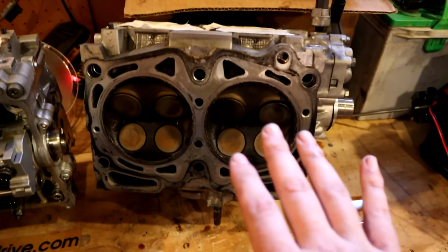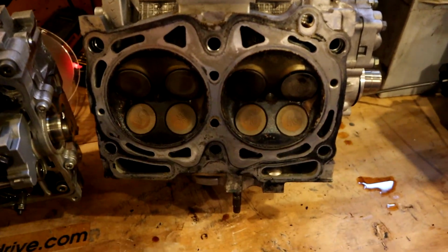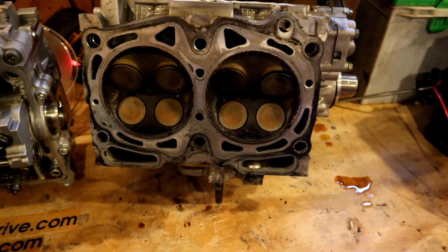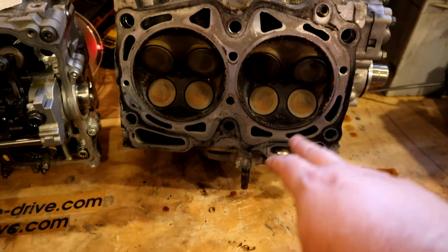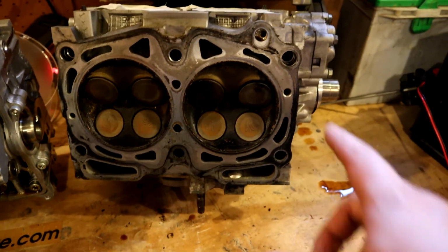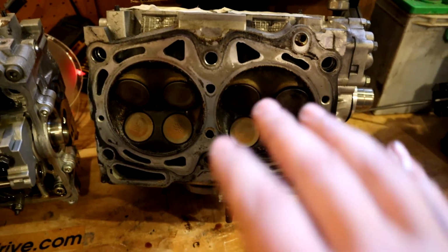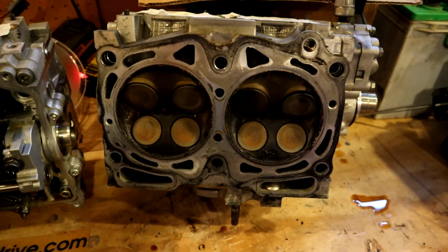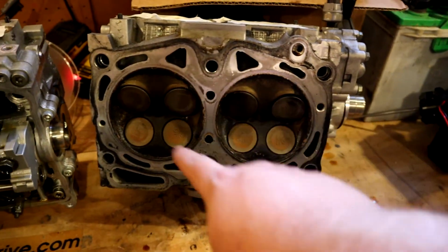And then here's the inside. So this would be where the cylinders are. So we're getting a cylinder point of view here. You see, you have your intake and exhaust valves. Intake valves are always going to be bigger because they don't have the cylinder pressure to help them evacuate, because you're essentially getting everything sucked in. So you've got your intake valves and your exhaust valves.